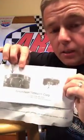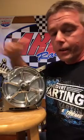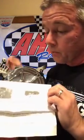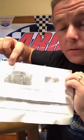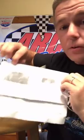This must be spun a minimum of 1500 RPMs, and very few drills out there spin 1500 RPMs. That's why we always send out the paperwork so that you can set it up statically without having to use a light, because the light will confuse it. It confused me the first time I used it. I'm like, these people say it fires here, and now I'm seeing it's firing in another spot because I wasn't spinning it fast enough. But just go by the paperwork. It's very easy to understand. Refer back to this video, whatever.